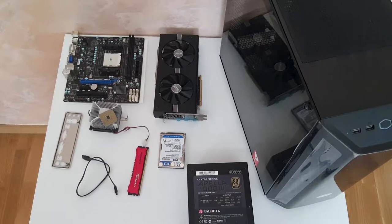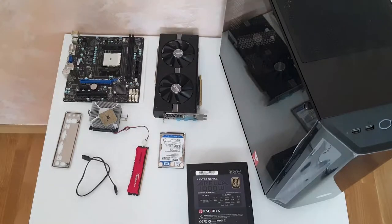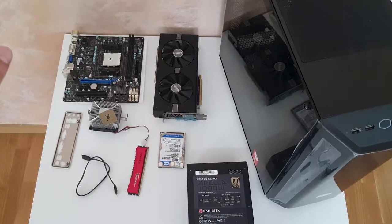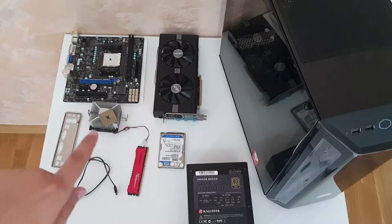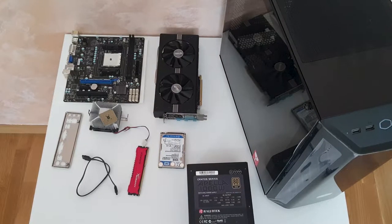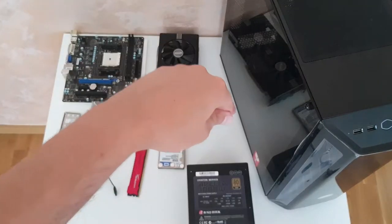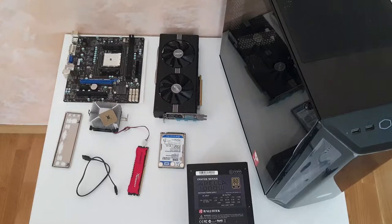Next, HyperX Savage RAM — also a gift from a friend from his mining rig. Last but not least, the motherboard: MSI FM2 socket A75 MA-P33, and the processor is the A4-4000, 65 watts, two cores, stock speed 3 GHz, turbo up to 3.2 GHz. If you want to see a better motherboard and processor, like, share, subscribe — and there's a Donorbox link in the description.